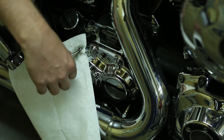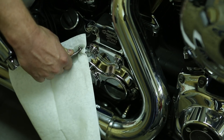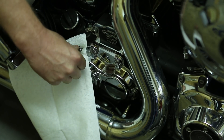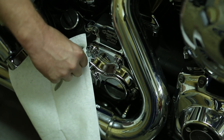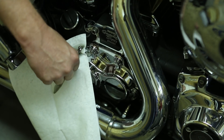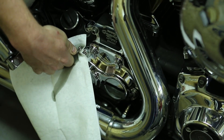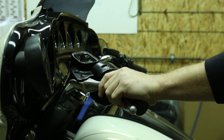I've got the clutch lever pulled in. I'm starting to feel the clutch being able to open up and you can really feel the springs on the clutch once it starts building pressure. I'm going to pull that lever all the way in again to the bars and crack the bleeder open — a little bit of air comes out there, still spitting fluid. I've still got pressure on the bar; close that off and start pumping up the master again. Just got to repeat this until no air comes out of the system.